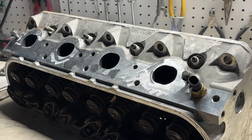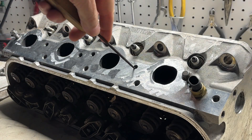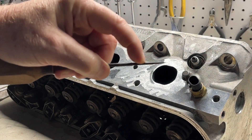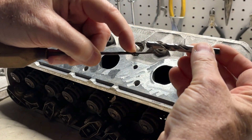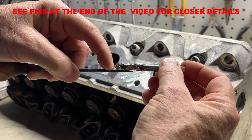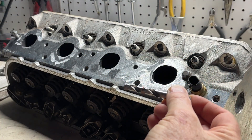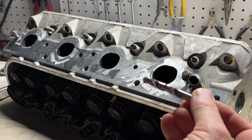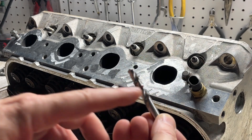To begin with, I used an instrument — in this case just an ice pick — to go into the hole to find the depth, pull it out, and see how deep the hole is. Then I took the drill bit I'm going to be using and marked that depth. It's marked in red right there on the drill bit, so I have a depth gauge on my bit and I know I should go no deeper than that. So let's drill the hole out to that depth.